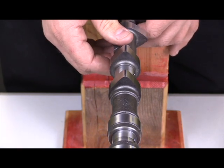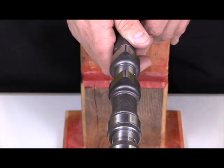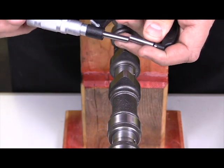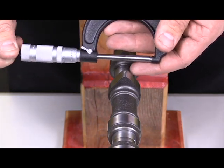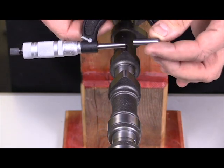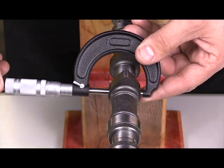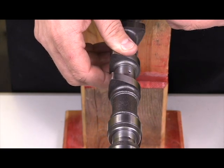If we want to measure the lift — the distance that we open the valve — we need to make a measurement here. I've got my micrometer; this happens to be a 25 millimeter metric micrometer. When measuring with micrometers, this will have a standard of 25 millimeters, and this is how I would zero out the micrometer. I've tightened it up with the ratcheting mechanism and zeroed it out. Any measurement I make I need to add the standard, which in this case is 25 millimeters. I begin by measuring the base circle, found by putting the micrometer at this angle, and I record that number.